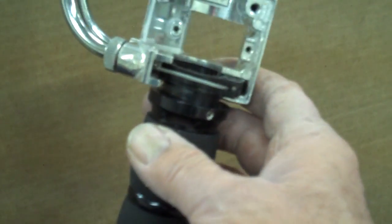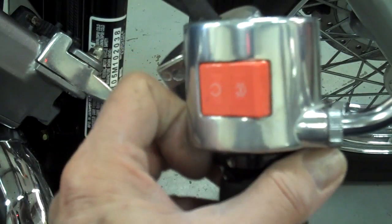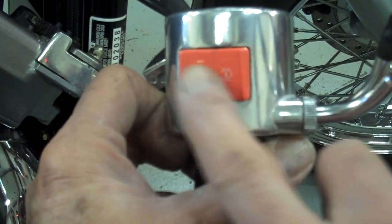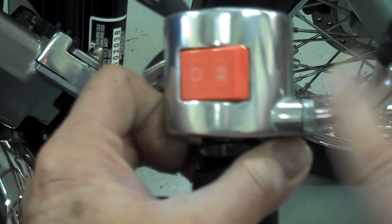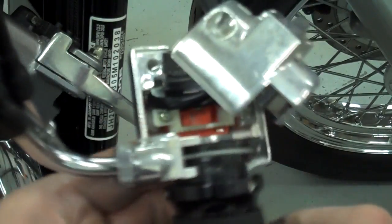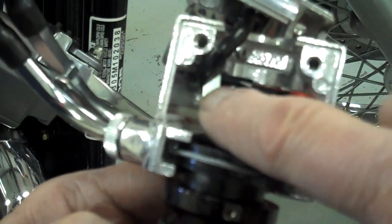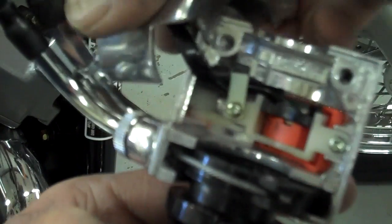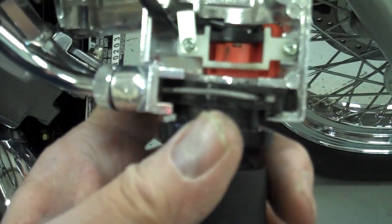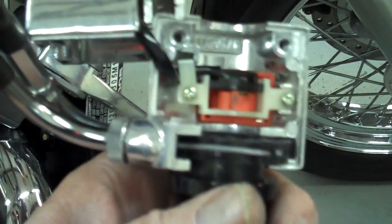For your reference on this switch — the cables come out of this side. This is the off position on the top toward the throttle connections. On the inside, there's a little bar that holds the cable. That's how the switch screws back in there. Go ahead and rotate it a couple times, make sure it clicks good, and then we'll go ahead and mount the bars.